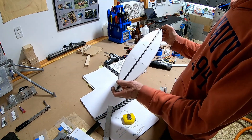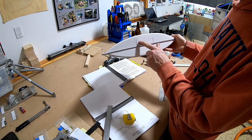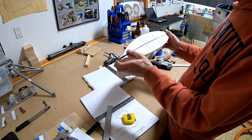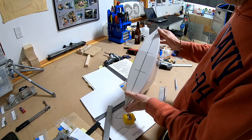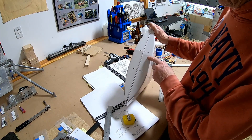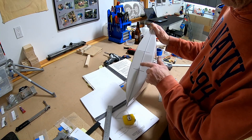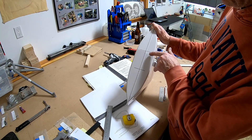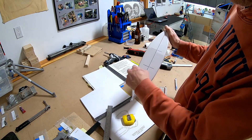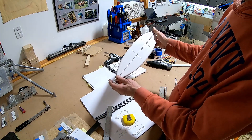I'm trying to figure out if I should center the cutout for the wheel strut or move it forward a bit. I noticed there's a crease in here which I assume contours with the front of the cage bends, but they're off by half an inch. On the right fairing, if you put it on the crease, a four-inch gear leg would be perfectly centered. But I think I'm going to move it forward so you don't see the crease on one side and not the other, since most of it will be cut out anyway — and it gives me a little more room for the brake line that comes out underneath there.